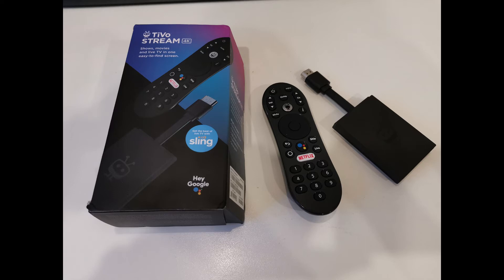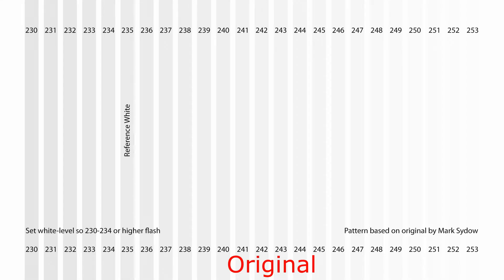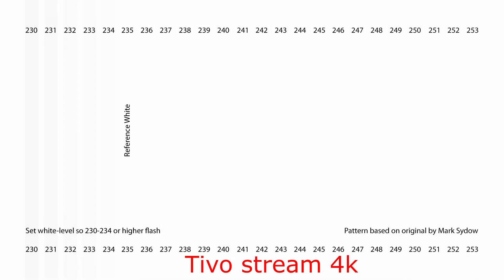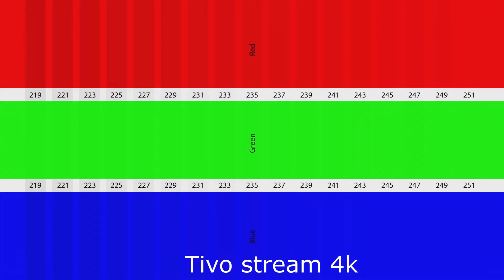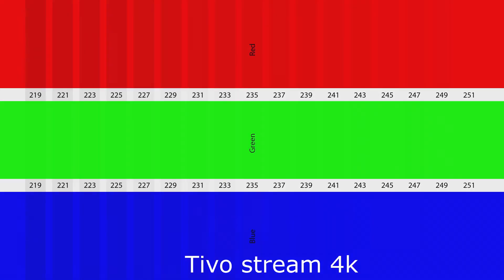TiVo came to the test with ATV9. As usual I installed Kodi, set the optimal mode for Amlogic — 422 12-bit — and made a capture. Already at the first video analysis in SDR, I saw a big difference from the original. First I checked the display of blacker-than-black and whiter-than-white — as you can see, they are not displayed, which is not a critical problem but it is there. Now looking at the clipping of the color channels — here we have a problem. This is how TiVo shows it and this is how it should be: a clear problem with color channel clipping.